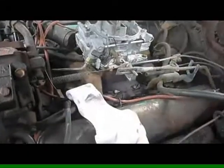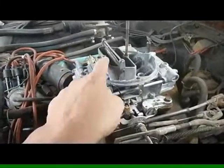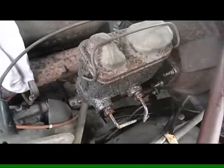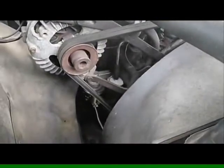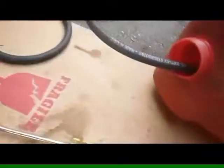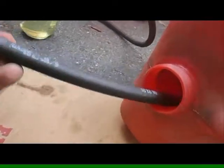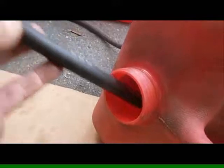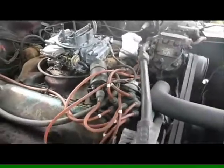We've got the carburetor all hooked up. I'm gonna prime it with a little bit of fuel down into the bowl over here at the vent. We managed to get the lines loosened up on the old master cylinder, which is great, so the original lines turn nicely — we're gonna get that changed in a few minutes. Right now we're draining through the fuel line of the vehicle — we are draining the old gas out of the tank. Doesn't look too bad since we did flush it out quite a bit, but we really want to be sure that no dirty fuel gets into the car. It's fresh enough to burn off in cars that don't have fuel injection — you mix in a gallon every now and then and that'll help. Everything's hooked up; we'll be ready for the startup in a few minutes.